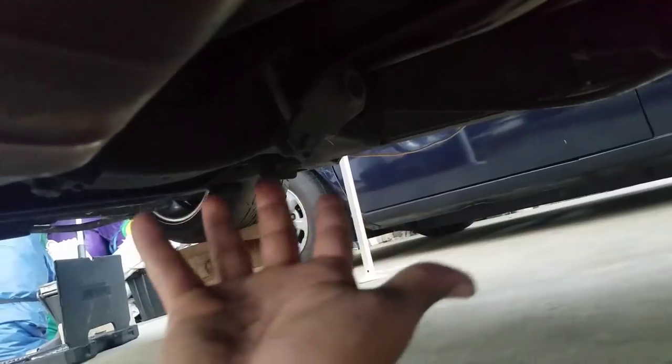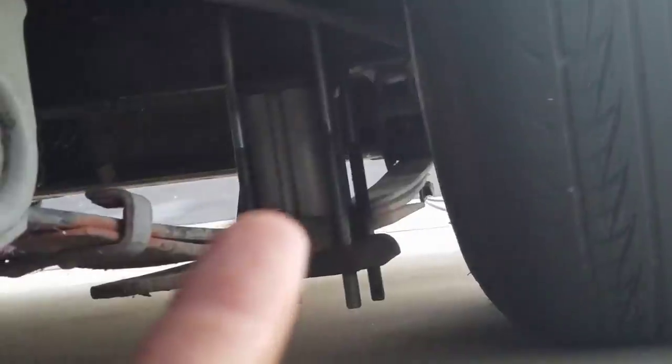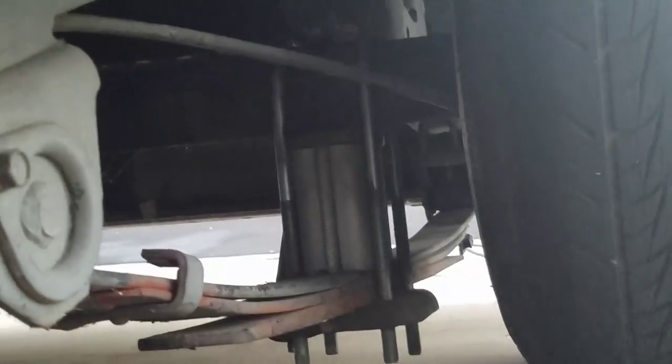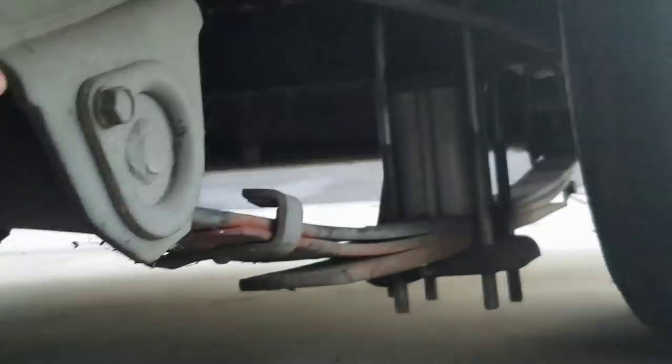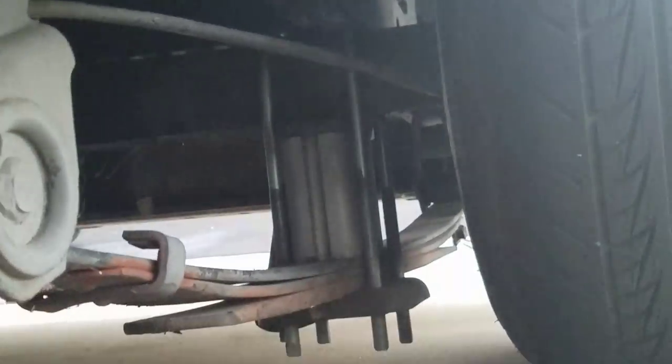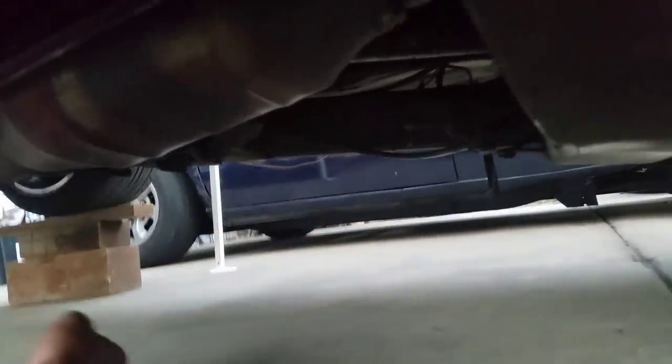Right in the middle of the door, come down here and you can see there's a bolt there and a bolt there — these are your torsion bars. When you loosen these, your A-arms go up and the truck drops. If you want to lift your truck, you tighten them. So pretty much you just loosen these and your truck drops in the front. In the rear, you have blocks — you take those four screws off, your axle lays on your leaf springs, and then you lift the rear axle, stick the block in, tighten it down with the U-bolts, and that's how you lower the back.